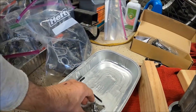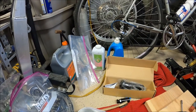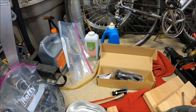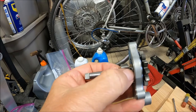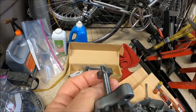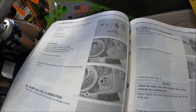We're still on part three — I'm calling this part three-A. I got into the oil pump and there are some witness marks on the gear. You can see a little witness mark there, a little indent, and then the other part of the pump also has that mark on it. There's also a little pin, and that pin goes into a hole on the gear shaft. On the other side of the gear shaft it's notched for that pin to fit in. All of this is in the book and it shows how everything goes together, including the witness marks.